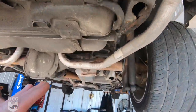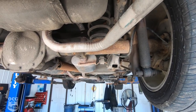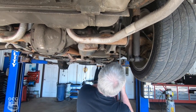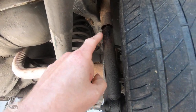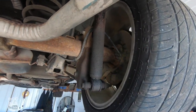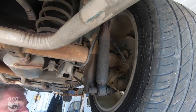One thing I said I was going to do is come in here and check everything and have it looked over before we did the swap, in case there were some parts I had to order. The car needed to be inspected for its annual inspection, so Tim's doing that now. One thing we do notice is that the two rear shocks are leaking from the top, so we'll have to pick up a couple of shocks. We'll start spraying down some of these bolts that need to be sprayed as well to aid in getting things taken off.